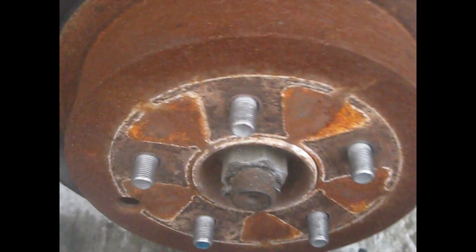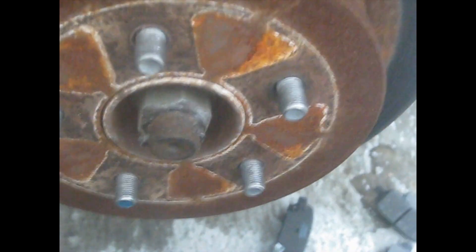The caliper you can just slide the bottom pin off like this, push it off and take it off. This is the bracket here, and now you take off the rotor. The rotor is going to be stuck on — you've got to release the emergency brakes to get the rotor off, then tap it out. The inside looks a little thin, so I'm changing it.